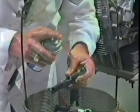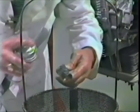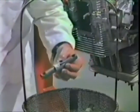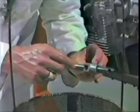Look at the intake rocker shafts. Pick the one that's the better of the two. I think this one here is the better of the two. You look at the shaft, not the middle aluminum piece. Okay, and we'll grab this. You arrange it in front of you so that the short end, there's a short end here and a long end, so the short end's on your left-hand side. It helps to do this where you won't worry about getting crud on things.